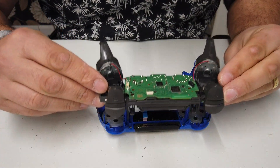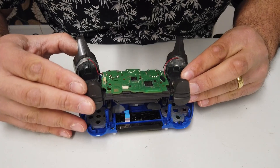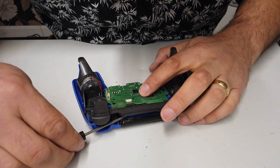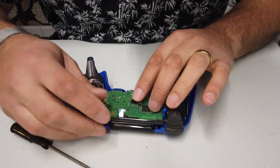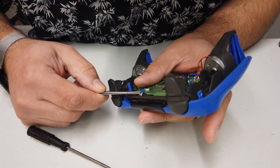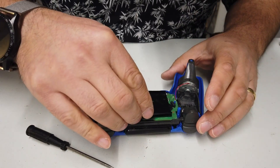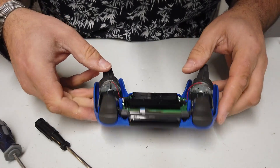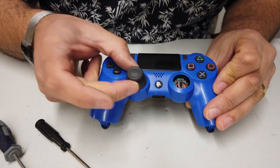When reassembling, do not forget about the little ribbon cables that you need to put back in place. Use a little screwdriver to make sure the ribbon cable pops up through the appropriate hole as you fit the assembly back, then use tweezers to guide the ribbon cable back in place. Battery tray on next. There's a little bit of random solder on the battery tray — whoops — and I dropped something in the handset. I always forget things like that — time to disassemble and reassemble.